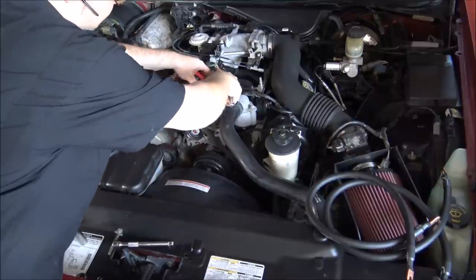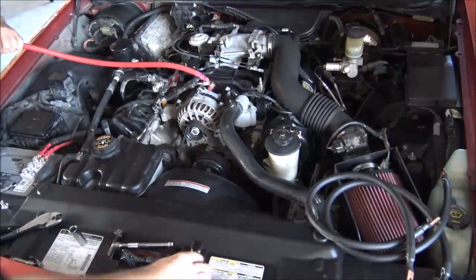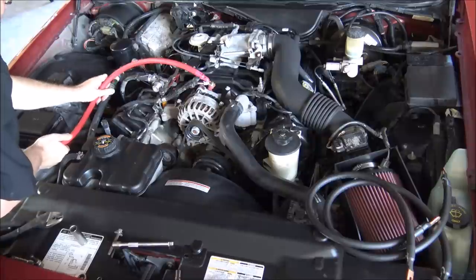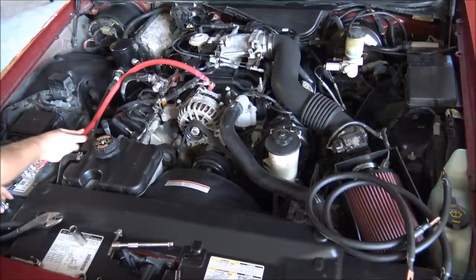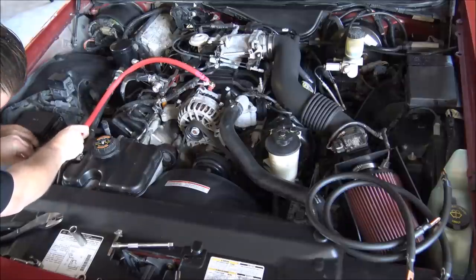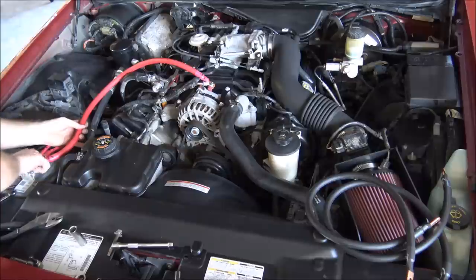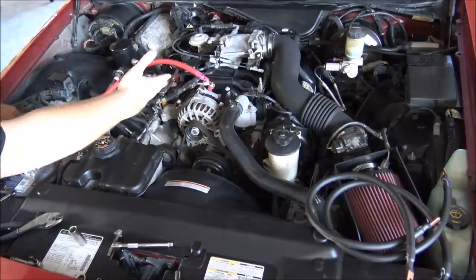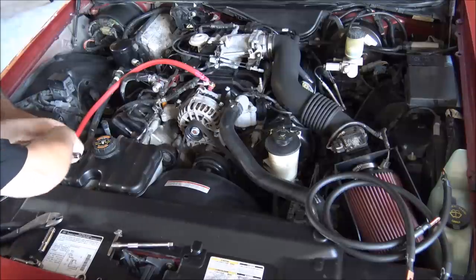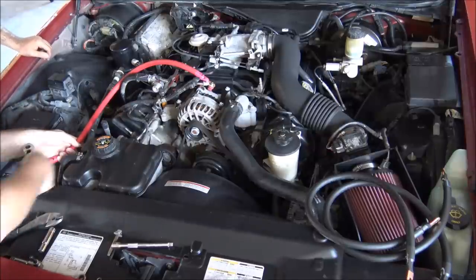This little grommet we'll just cut off. The wires will be loosely ran in the beginning, then we'll go through and zip tie everything and clean it up. The way we did this one was that it's going to flow with some of these wires right here. So there's our positive power going to the battery positive. If you're not familiar with what the big three is, it is what allows your car to essentially open the floodgates on your electrical current flow.